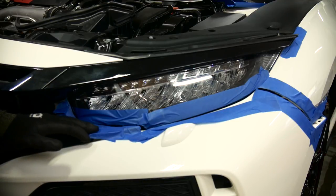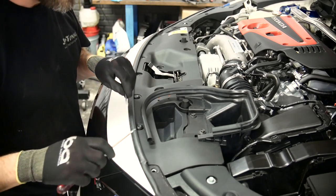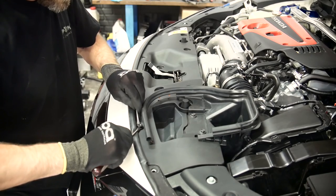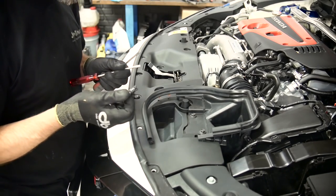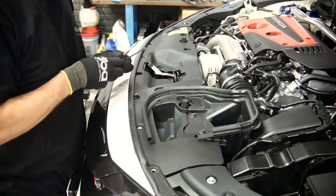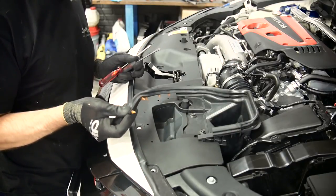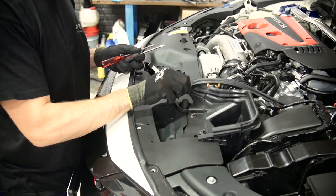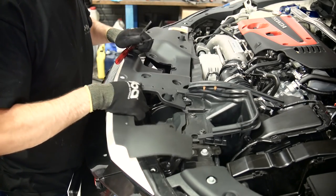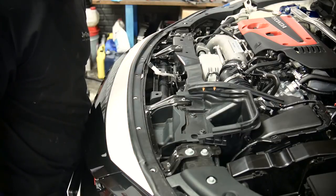So just be careful so you don't scratch the paint. To be able to take the front bumper off you first need to remove a few clips up here, and you just easily do this with two screwdrivers — you lift up the little nail piece and it will come off just like this. You need to do that with all of these clips. Then you need to remove this rubber seal, which sits with clips, and when that is removed and all the clips are gone you can just easily lift off this cooling plate, and then we can continue with the front bumper removal.